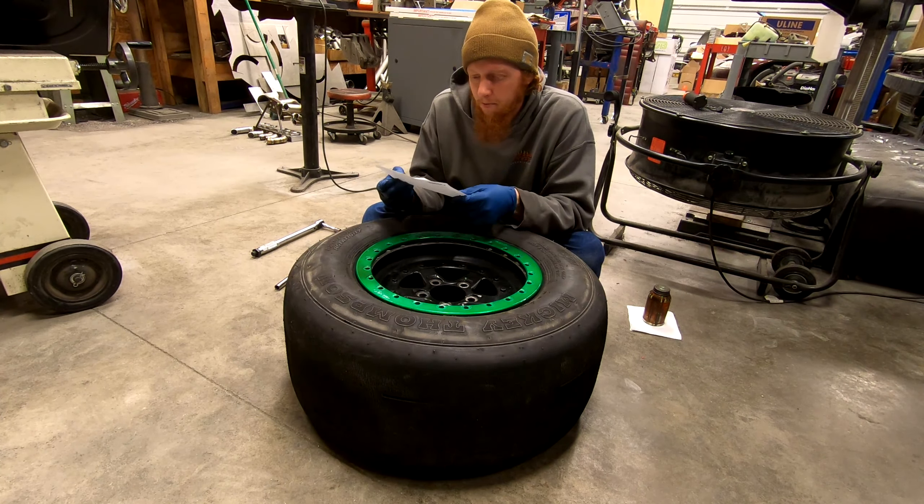To start this, I'm going to use this speed wrench and just gently get everything seated. We'll start on our two reference bolts and work in a clockwise rotation around here. We'll keep working around until we have all of these at least snugged up, and then we'll move on to the torque wrench.